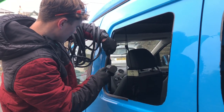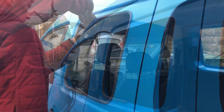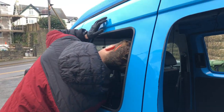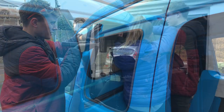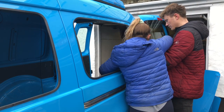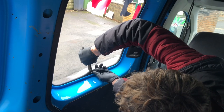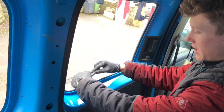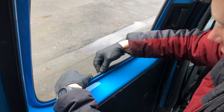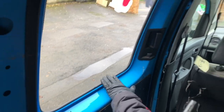Next was to add the knock-on edging trim which we bought from Van Demons. We opted for the smaller 2–4mm trim that only covers a single skin but will give a nice finish on this Caddy. Knocking it on is a simple process with a rubber mallet. You want to cut the trim a little bit long as you can push it back into place and it ends up fitting a lot nicer. Lift the end up, get the front into position, and it buttons up nicely. Tap it down and you get a nice seamless joint.